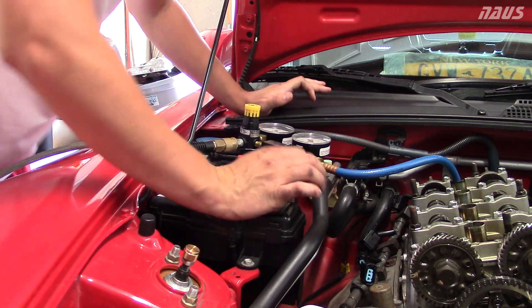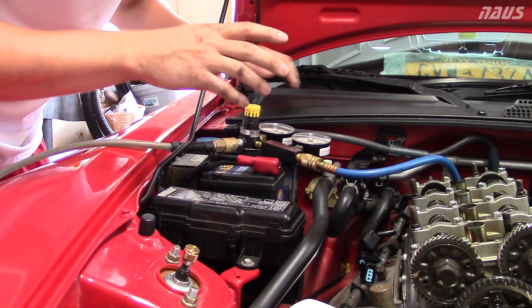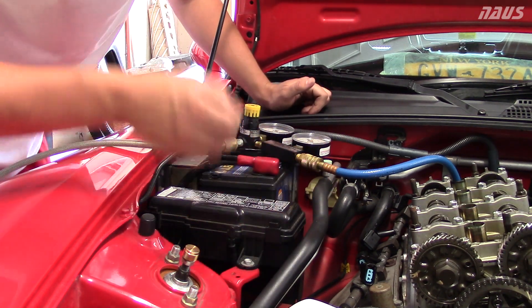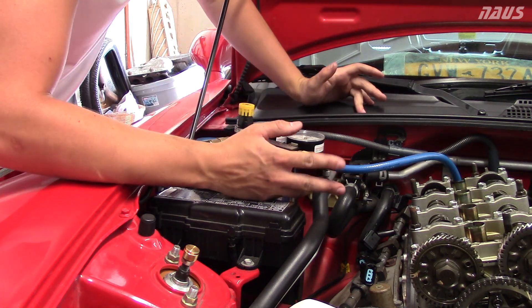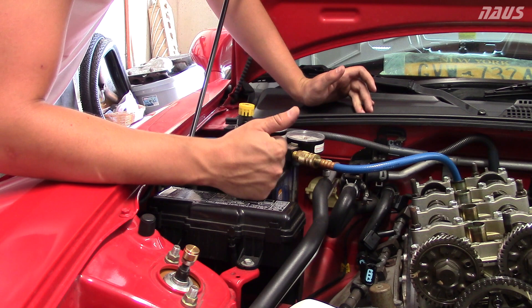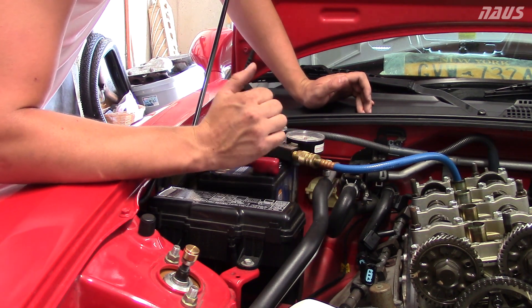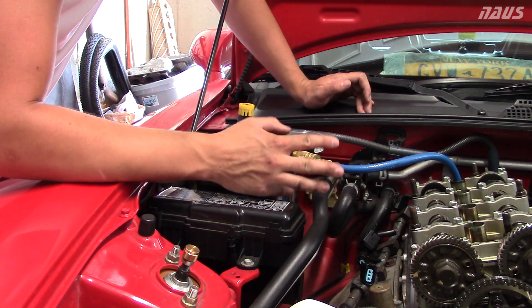Your main concern is to listen at the intake on your car. Put your ear by the intake — if you hear no air hissing there, your intake valves are good. Then stick your head near the exhaust pipe and listen for any hissing. If you do hear hissing in the exhaust pipe, that means you're leaking air past your exhaust valves, which indicates a bad valve seal, a bent valve, or the seal not happening between your cylinder head and the exhaust valve.